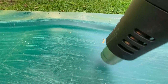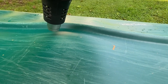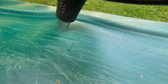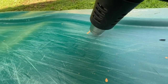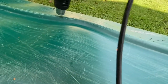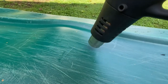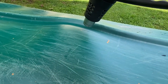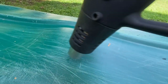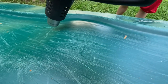I want everything to heat up nice and even. I'm going to heat up a little bit past it too, because you can see I got this big wave right here — a big bulge — we're going to get that out too. I'm going to go ahead and get the keel rib straightened out, and we're going to straighten this out too. You're going to work from end of the bulge to end of the bulge, back out here a little ways, and we're going to do it slowly and evenly. I'm going to go ahead and set the camera back up and we'll time-lapse this, then look at it whenever it's done.